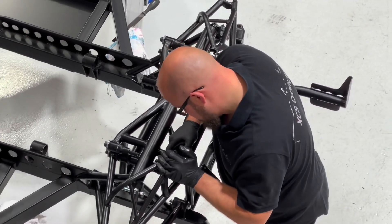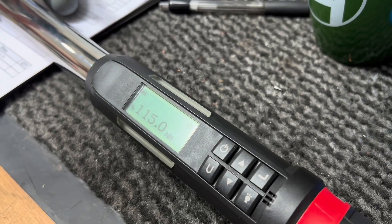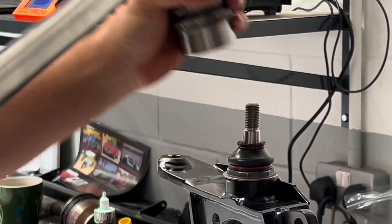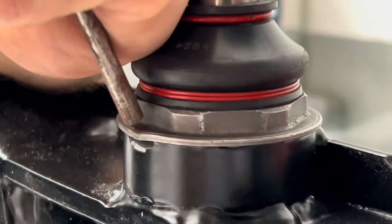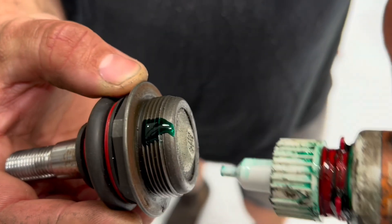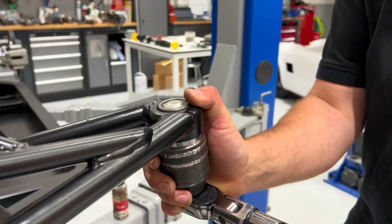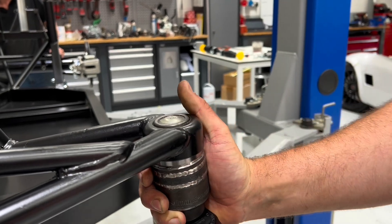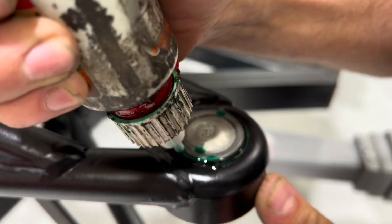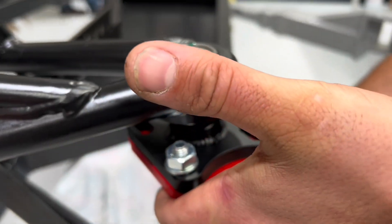You can now go ahead and do the same thing for the other cross link. The front hub ball joints need 115 Newton meters of torque and you can install with Loctite — you'll also see we've filed a little notch for the securing ring to be fitted. Make sure you're using plenty of Loctite. This is the ball joint going into the top A-arm; once it's in, again 115 Newton meters on the torque wrench, and then a good helping of Loctite on the top edge. This is the top plate for the front hub going in.